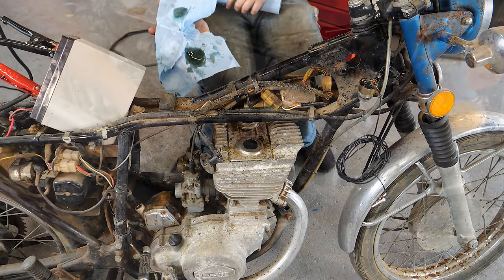Come on, girl. Starter's just not doing it, but it's trying to run when I shut the throttle off. I'm gonna pull the plugs again because I'm sure they're fouled and it's kind of hydrolocking again. But if we keep this up, this might work out. Alright, one more time. I did notice that there's a couple plugs missing out the bottom of the carbs, so before I can hook my fuel tank I just rigged up to the carburetors, I might have to drive home and steal those off the parts bike.